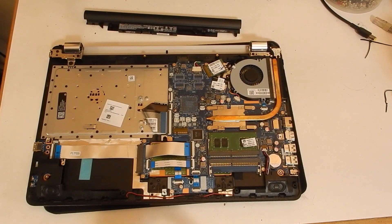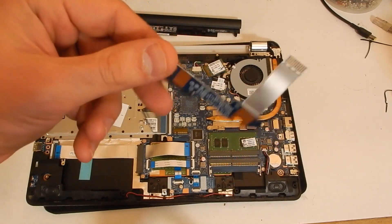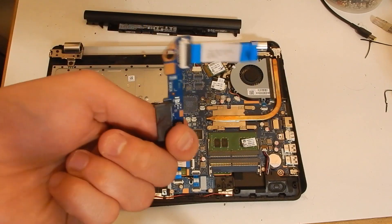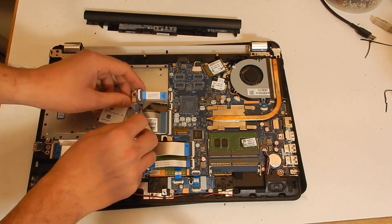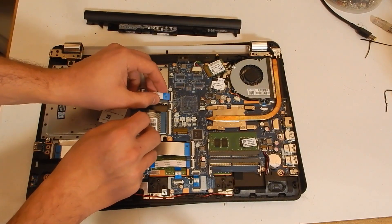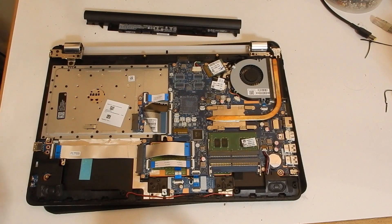Because of this, HP did not include a mini SATA connector, but we can actually add one from a similar HP donor machine, because the ZIF socket on the motherboard still supports the connection of the mini SATA for a CD-ROM — and look how nicely that fits in there.